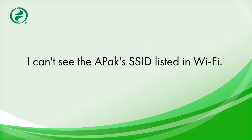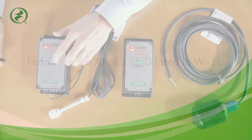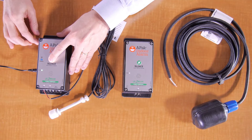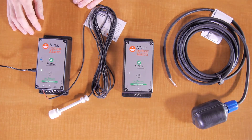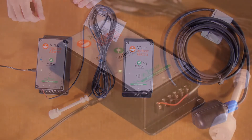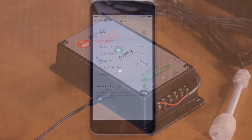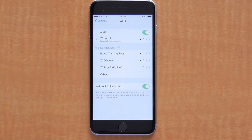If you can't see the APAC's SSID listed in your Wi-Fi settings, you probably need to reset the APAC. Do this by holding the silence button while plugging in the AC adapter's barrel connector. Let go after about three seconds. This wipes out any saved Wi-Fi info that the APAC had. Now check the list of available Wi-Fi again.